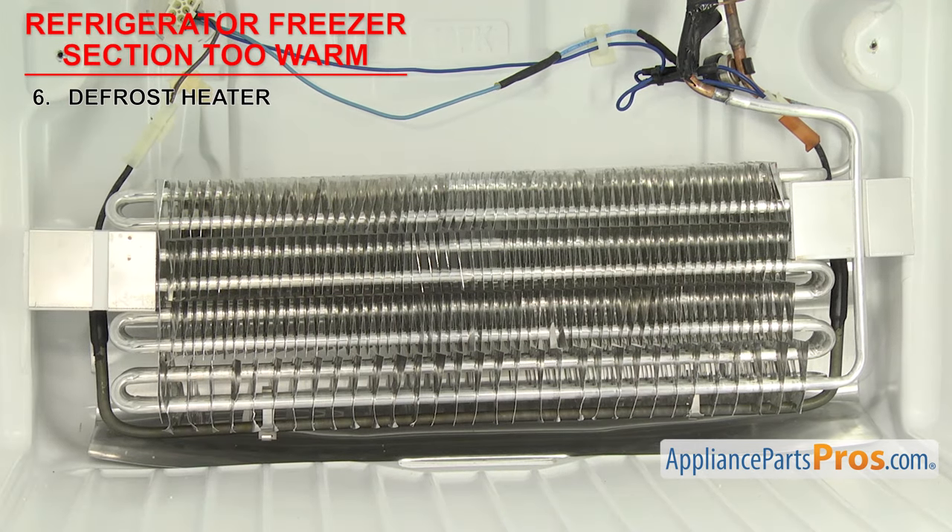Here's that money-saving tip we mentioned earlier. If your freezer compartment isn't getting as cold as it used to and your ice cream is getting soft, it could be that your condenser coils are dirty. Dirty coils can cause the freezer to run warmer than normal if the condenser and other components are covered in dust and pet hair, which insulates the coils and prevents them from working efficiently. This can also make the refrigerator run more, causing wear and tear. Keeping the coils clean can improve your refrigerator's efficiency by 30%, saving you money on your electric bill and future repair costs. To clean them, pull the refrigerator out and remove the rear access panel — some may be accessed from the front. Use a condenser cleaning brush to reach in, and also clean the compressor, condenser motor, fan blade, and wipe down everything else. Be careful not to damage anything, and do this at least once a year.